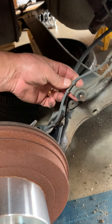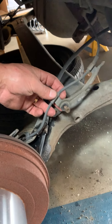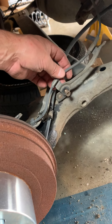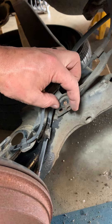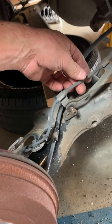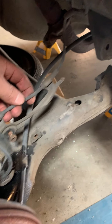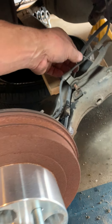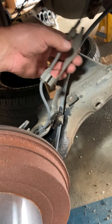The other thing you want to do is, this is the ABS sensor on the rear. I had a scare that I damaged the one on the front doing this already. So this just — it's a 10 mil right there — goes through there, boom, that plugs in down. As I'm dropping this rear axle, as you can see I've got the mounts out there. You don't want to stress that either, so just disconnect all the stuff so you're not yanking on those wires.